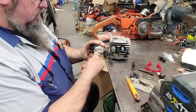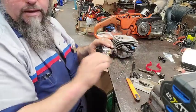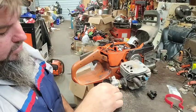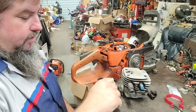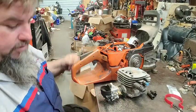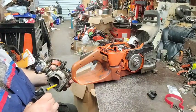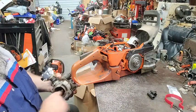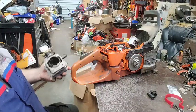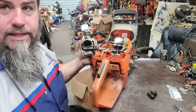Well, hold on, choke won't work. All right, ladies and gentlemen, and fellers, and fellettes, and all the rest of you. Whatever. I got the choke working. The butterfly on the choke was a little bit loose, and it had got befuzzled. So I straightened it up and unloosened it.